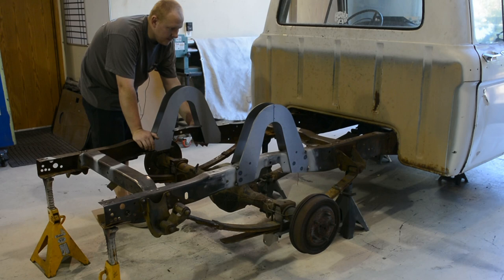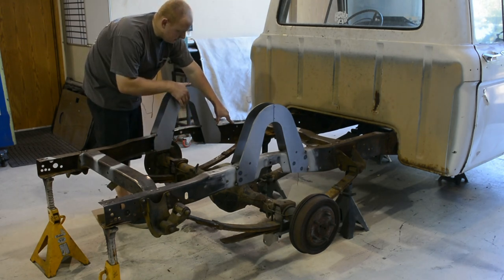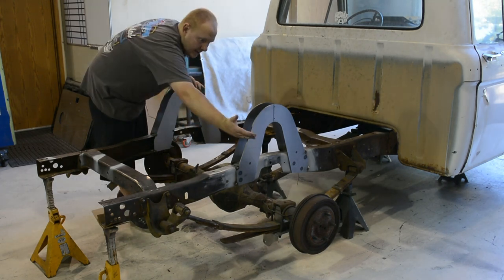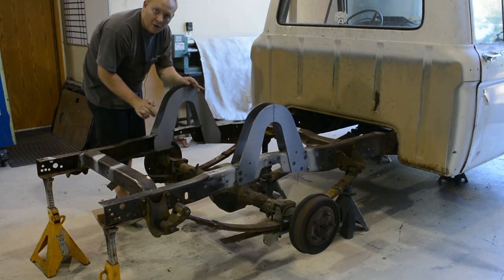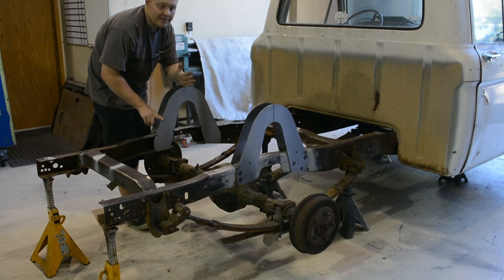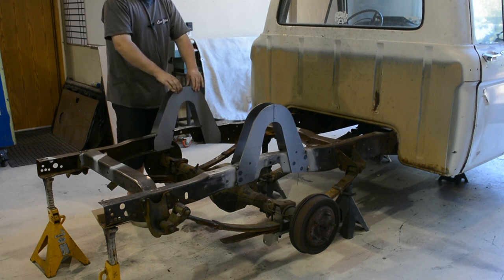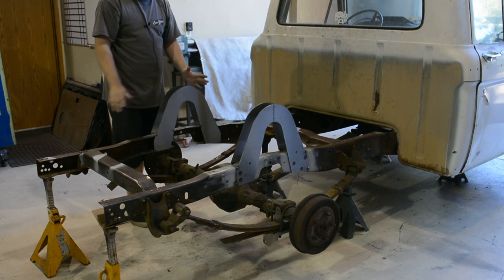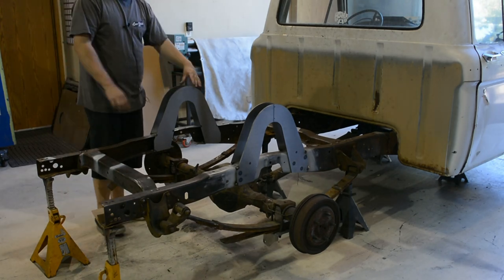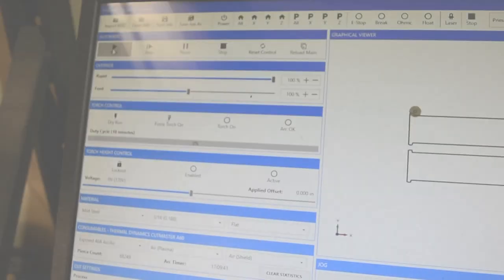Clamped on the bottom side of the frame, a crossbar, and that crossbar sits right where my notch was sitting, so I could put the inside notches right on top of those crossbars, put my long level across, and make sure my level's hitting all pieces of the notch, forward and backward, and on the very top. So we're looking really good. As far as the notch springing in and out right now, I can squeeze it in, I can move it around with my hand. That's nothing to worry about, we got it close. So once we start to cap this and add cross members, we can make sure it's dialed in and nice and square to the world.